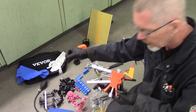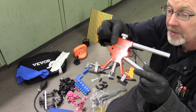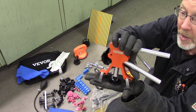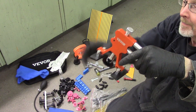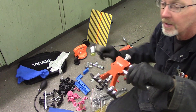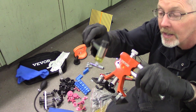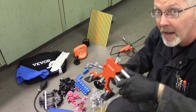With these wonderful little pads, I quite liked this one — you can hook it onto the pad on the body and just squeeze and pull that up to help pull the dent. I think it's smart to tap around the dent with this to try to bring the high parts down while you're pulling the low parts up. That's just me.